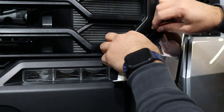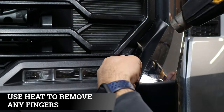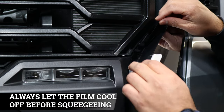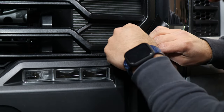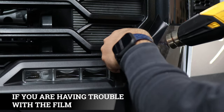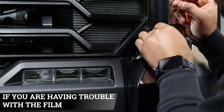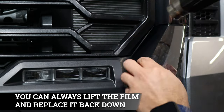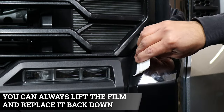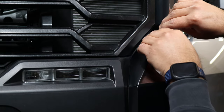Lift the film up and work your way placing the film here. You're going to come across some fingers, so just pull the film a bit — try not to stretch it when pulling — and apply heat so those fingers go away. Always let the film cool off a bit before tacking down, because you might accidentally crease or stretch it if you don't wait. Then place at an angle and rinse and repeat.